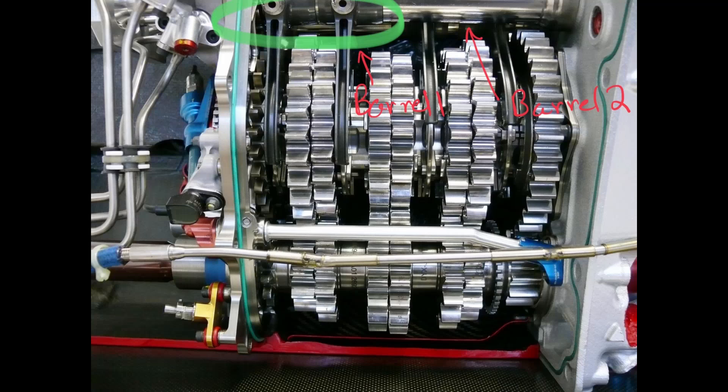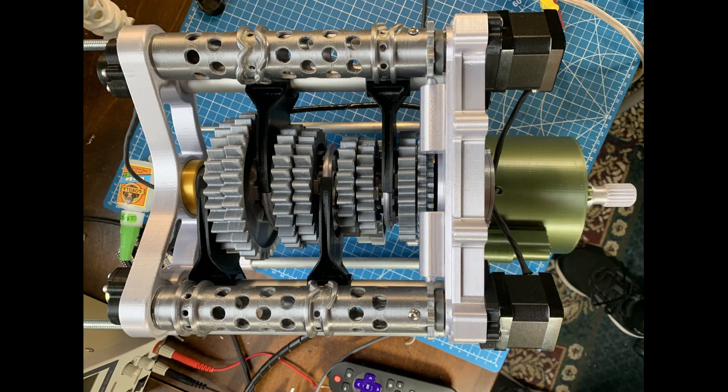With two shift drums I think it comes out to nine states per shift drum. Toyota actually integrated the shift drum itself into the shift fork tube — it was actually inside of the shift fork tube, and they had a little slot that the pin would slide up and down on. So it could be a very compact design with two shift fork tubes essentially side by side. Alternatively, you could have two shift drums external to these tubes, but then you're starting to get into a pretty large gearbox, which was part of the issue with the previous generation X-TRAC gearbox that my first F1 gearbox model was of — it just was not ideal from a packaging standpoint.